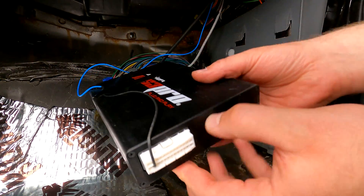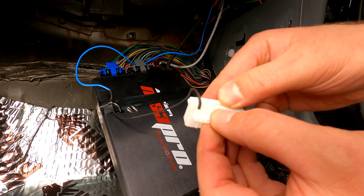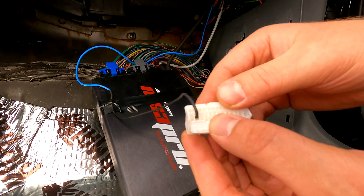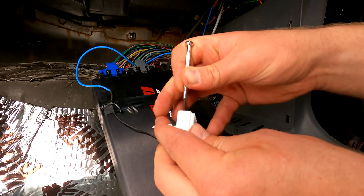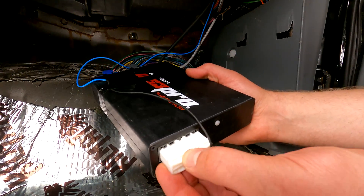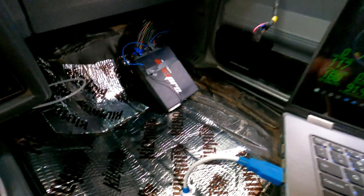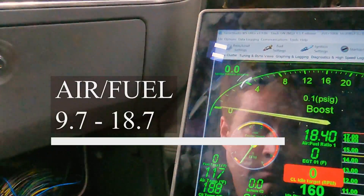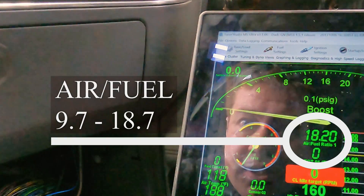I got an idea that maybe I hooked this into the wrong pin. Okay, that came out pretty easy. Now I just need a small poker to poke in there. Okay, that worked — plug this back in, let's see if this worked. Showing 18.4, and I'm going to unplug this connector and see what it shows then. Perfect — I had it in the wrong pin. So that should be working now, and the ECM reads the sensor.